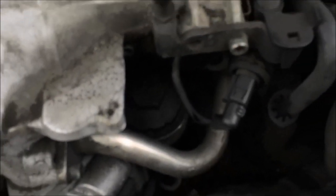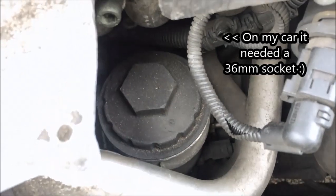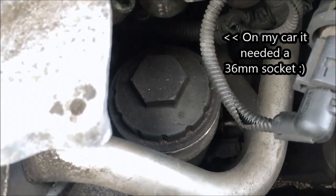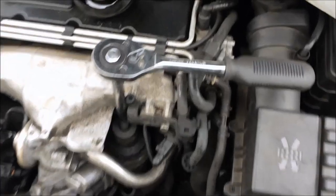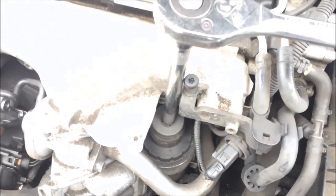If you look now, there is actually the oil filter, like that. So now you've got to get a little socket, stick it on there, find out what size it is, mix and match, and obviously unscrew it a bit — loosen it, then do it by hand so you're not going to spoil the thread on it. Once that's all set up, you've got your ratchet nice and snug in there, you can start to loosen it off.